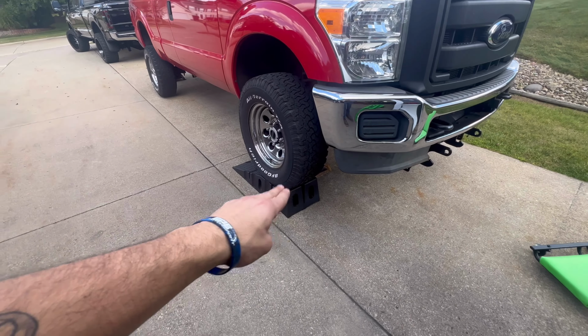Now, a lot of you guys, and even me, will take a flat blade and pry at it. But if you saw on the end of my last time lapse, a little trick for you guys is all I did was shock the whole cover. From here, all the main parts of the cover, I just shocked it with the little 16 ounce hammer, and it broke the seal loose, which I figured, why not try it? So there's your lovely oil, man. Whew, smells stinky, but I got it shocked, broke it loose. I'm gonna pry it more here in a minute, but I'm just letting most of that drain out right now. So keep the time lapse rolling.